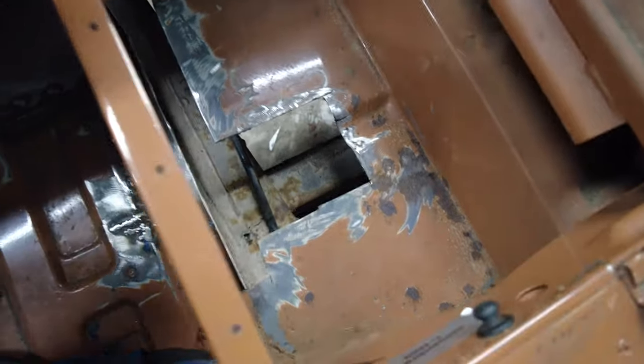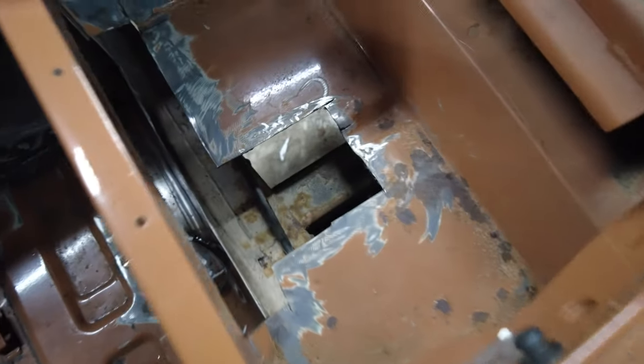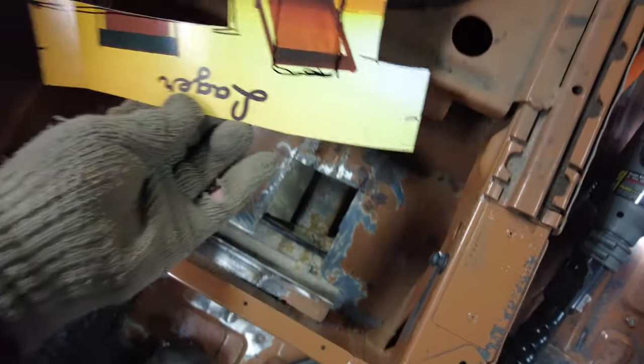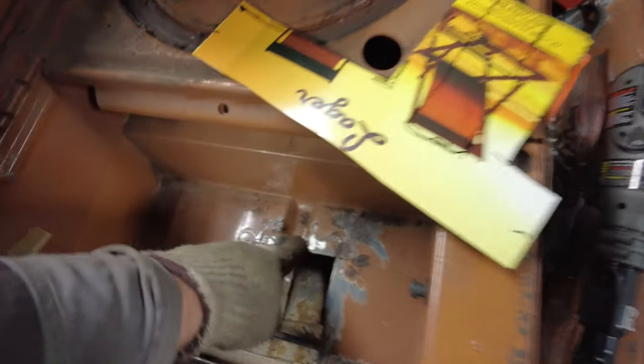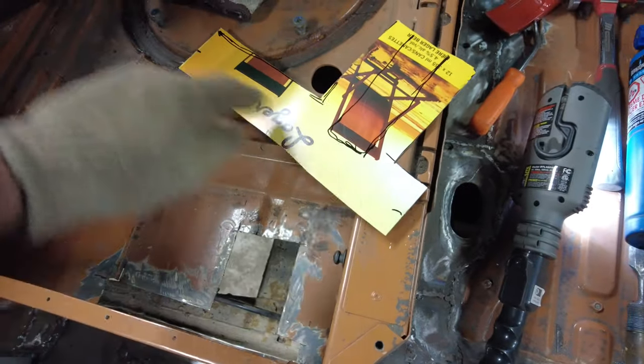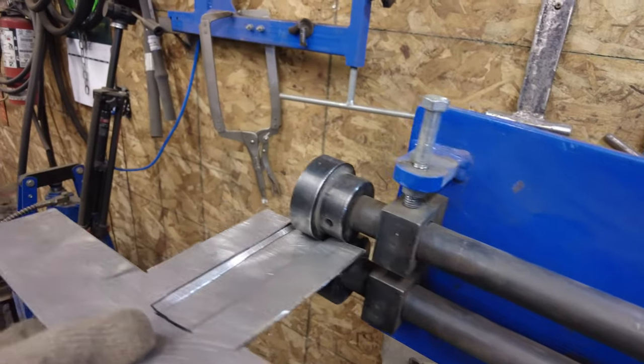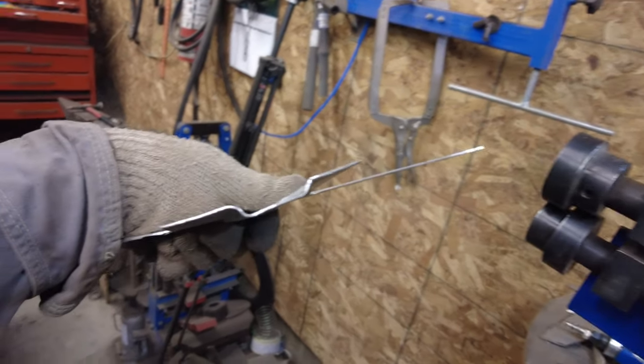I think first off I'll put this piece in here, which I have to make, and that's got a hoop-de-doo in it. Goes about to here somewhere. I'll have to find the old one that I cut out and see. Yeah, so there's the hole in there, right? And here's kind of a pattern that I've cut out. And so this bit here is where the hoopy thing goes in, right there. And then there's a flange that goes across here. We'll see if I can make that sort of fit. Yeah, so I've run the bead roller across this and make that hoopy thing in there.